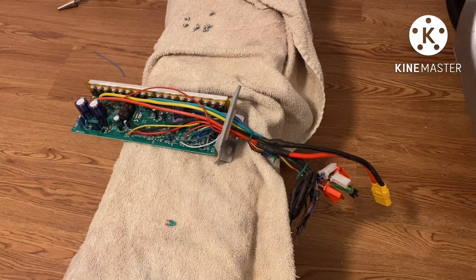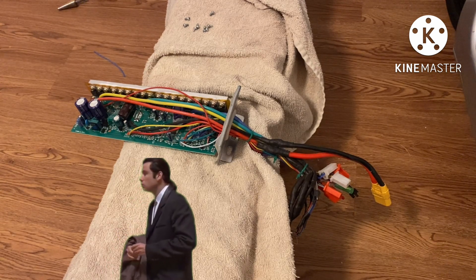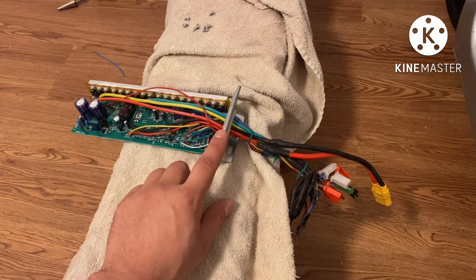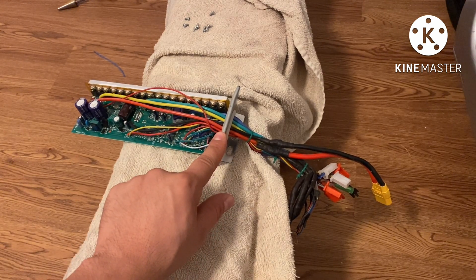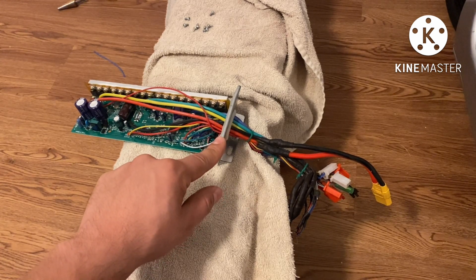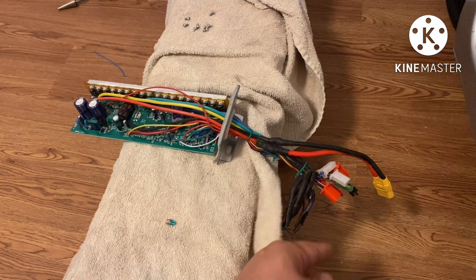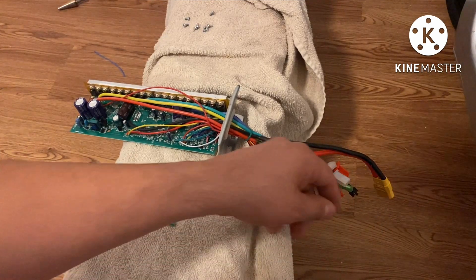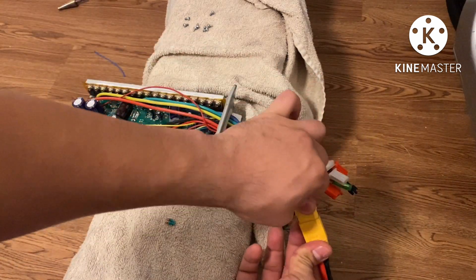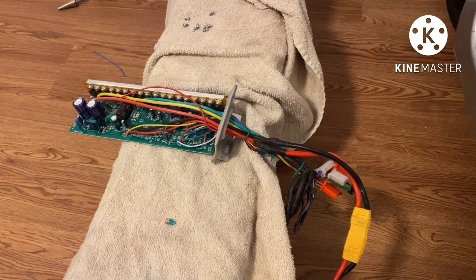A question came up in my comments: what if the controller does not have K2 or K1 pins to activate your third speed? It's a good question. For example, this controller does not have the K1/K2 pins for three speed. In this situation it's a little different — it does have the three speed switch, with gray, black, and red wires. Let's plug this up so I can demonstrate how this works, and give it throttle.